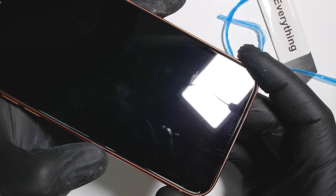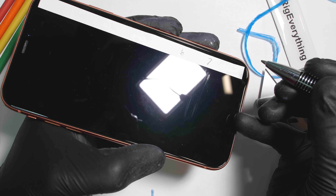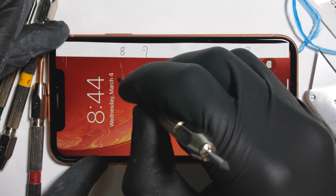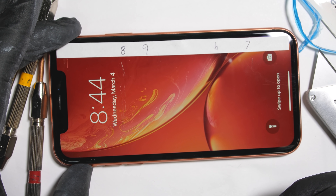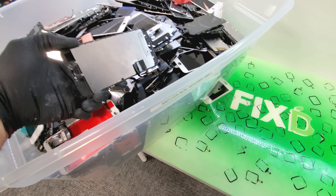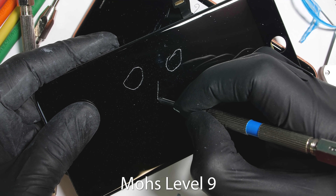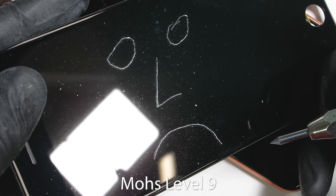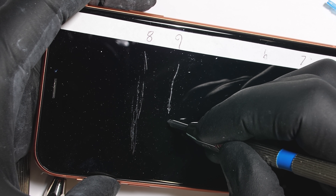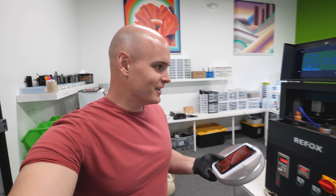Now I have one of my iPhone XRs, and as you can see, it still has level 6 scratches with deeper grooves at a level 7. Normally I stop at level 7 because any more damage would be excessive. But I think today we can make an exception. If your phone sustained a level 8 scratch in real life, it would probably be broken — they're more like gouges in the screen. A level 9 scratch is something entirely different: instead of gouges, it scores the glass and cracks it all the way through. I doubt we can get rid of a level 9. So we have level 6 scratches, level 7 deeper groove, level 8 gouges, and a level 9 score across the surface of the glass. Let's see what can be removed.